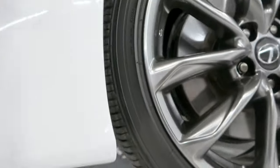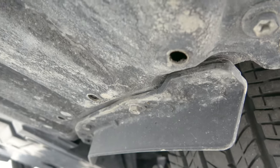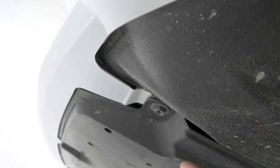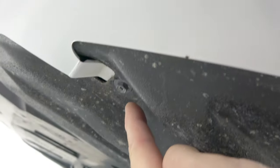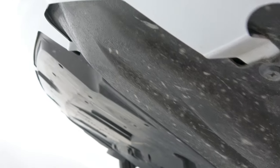On the bottom side, we have a few screws. There's a 10 millimeter right there, and there's two right back here. So we're going to remove all of these 10 millimeter screws. There is one right there, two, three, four, five, and six - one way over there. Six on each side. That's what you have to do to remove the bumper.